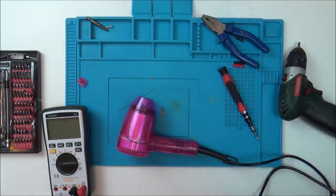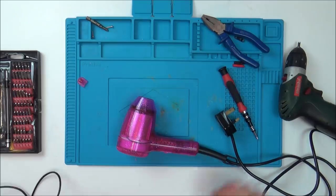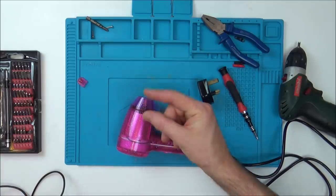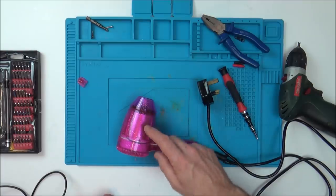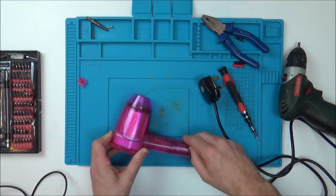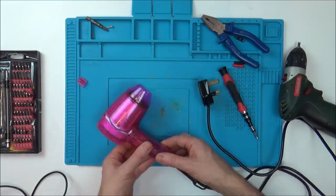It's working absolutely fine now, so by now it's cut off way before that. I've just unplugged it again. I'm wondering - could it have been something to do with the trapped hair? Maybe those bits of hair were going near to that thing that cuts off when it gets too hot. Maybe it was the hair burning or something. Or maybe the hair getting trapped slightly in the motor causing a bit more friction - or could it have been the hair arcing between the coils? What I'm going to do is take it apart again, clean it all, then put it back together and leave it on for a good ten minutes to see if that fixes it.